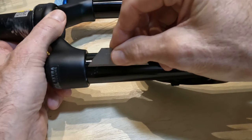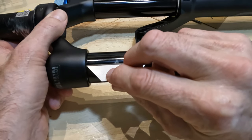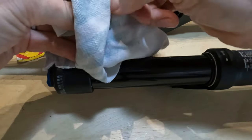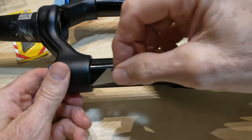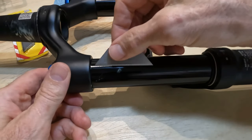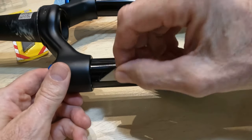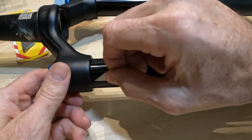Working both scratches at the same time since they're close together — down and back up — being sure to continue cleaning the blade in case there are any particles. I've actually gone over this prior to the video, so I'm demonstrating the procedure again at a 45-degree angle. It seems to be a little easier when you're pulling versus pushing, but you don't want to go too hard into it. This one still has a little bit of a rise, so I'm taking it off here.